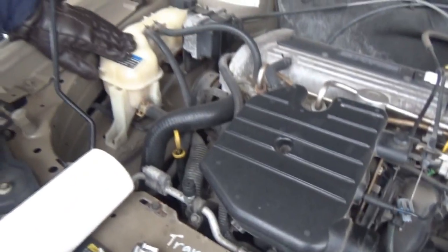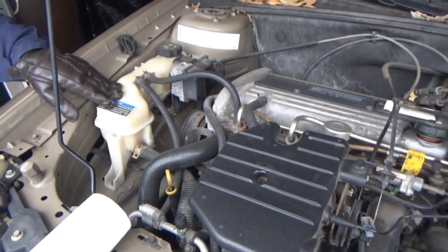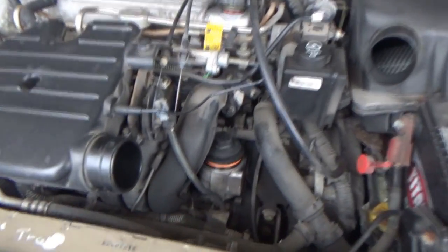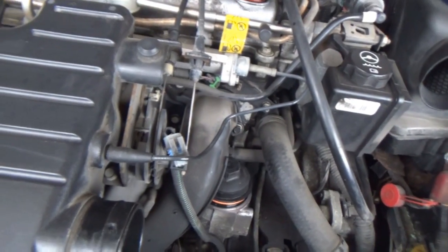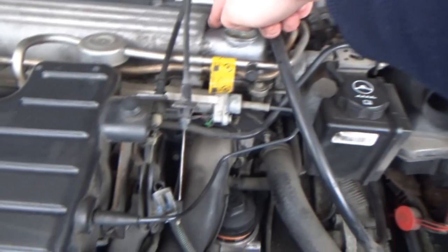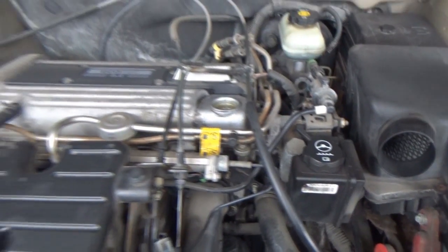The bottle's old — she does need a coolant flush. That's still the original Dex-Cool in there, which I'm obviously not a fan of when it comes to the gaskets from this time period. Look at this — when I put Sea Foam in here last time I spilled it on here by accident, and I took a rag — look at how nicely all that cleaned up. I can just imagine what it does on the inside.